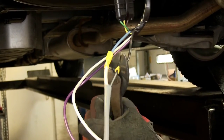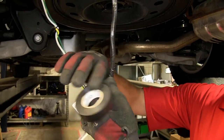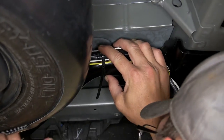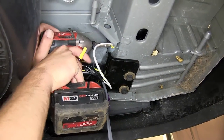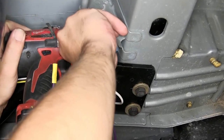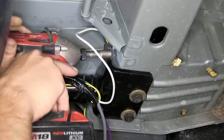Now with all these connections made, we'll go ahead and continue wrapping up our wires with the black electrical tape. We'll need to secure the wiring to the back of the hitch and run it over to the frame. Now with the wiring over to the frame, we'll take the white wire with the pre-attached ring terminal and the self-tapping screw provided with our install kit, which will be the new ground for our 7-Pole Connector, and ground it here directly to the manufacturer's frame.